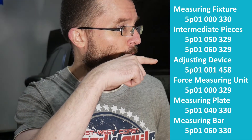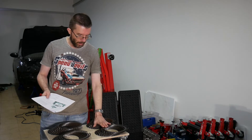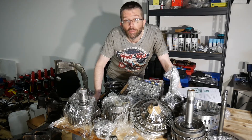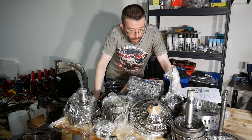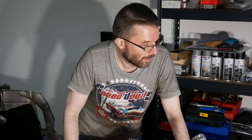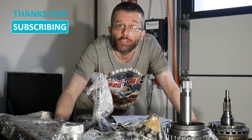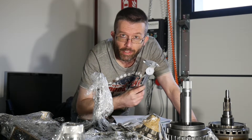After studying this manual maybe half a year ago, I decided just to drop in new clutch packs and hope for the best. Then I arrived here yesterday to pre-soak the new friction plates — a frequent viewer had reminded me to do so, thanks Adam. Looking at the beautifully rebuilt components, an inner voice told me: no, you can't do this. Setting proper clearances is the most important part of any transmission rebuild and essential for good shift quality. I studied the manual ten more times, eventually figured out what value F is and that it isn't relevant at all if doing the measurements a different way. I picked up this caliper gauge via click and collect.